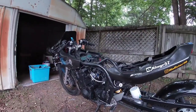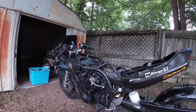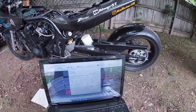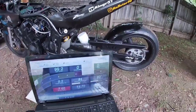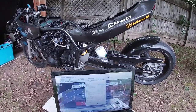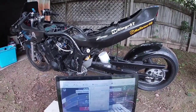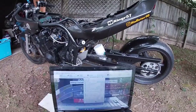It's spraying. Now we won't start the bike for a while, but that's more or less how it's gonna go. So F idle works. So now I'm gonna come over here. I'm gonna close this. We're gonna go to boost and advanced. Nitrous system on above 6,000, coolant temp 120, TPS 80%, spare ADC is the input still. I'm going to leave that the same. F idle out, well, I figured that out a second ago.